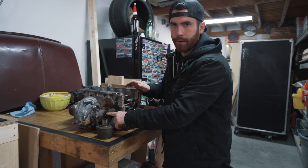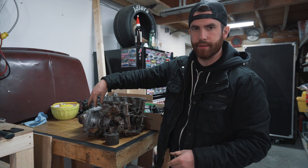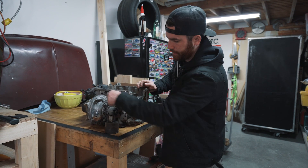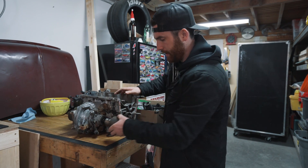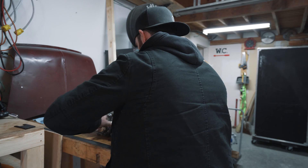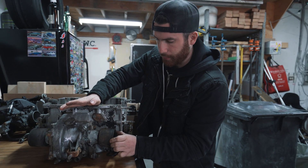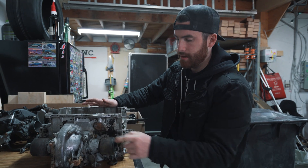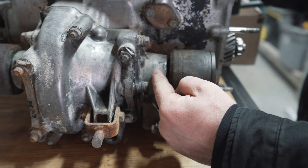Now one thing to notice: if it is leaking from here, it might not be the seal. There are two bushings inside the diff — one from the inboard side of the differential on the planetary gear on the inside that needs to be pressed in and reamed, and then there's also one that sits right in the side covers and rides against this. If these are loose — if this here is loose and you can see on this one it is knocking back and forth — there's a good chance that just replacing the seal on the outside of the diff cover won't actually fix the leak, because if this is allowed to wobble around, it's only a rubber seal and it's just going to leak past.